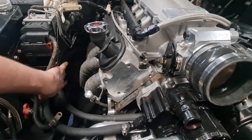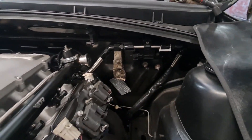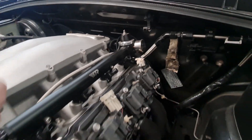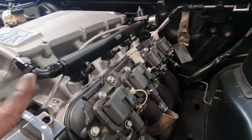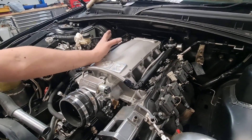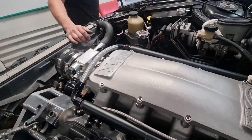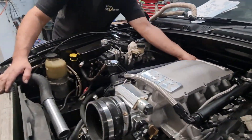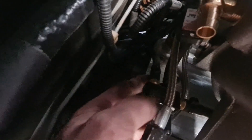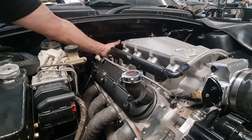As far as the manifold goes, we've had to change our fuel system — basically the way the whole fuel system runs — changing the location of the pressure regulator and the way the fuel system runs around the car. We've also had to change the vacuum system, as the manifold didn't come with enough small outlets to run the required accessories, MAP sensors, and various bits for this car. So we've done a vacuum block down the back of the car — a block with a single connection in and multiple connections out — that's how we've got all the vacuum connections we require.